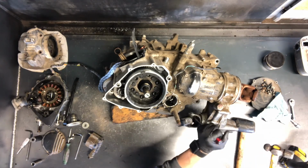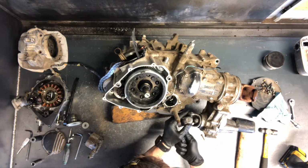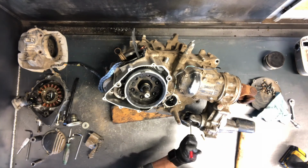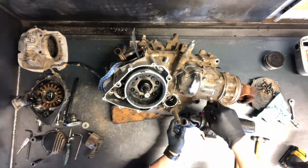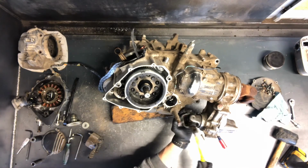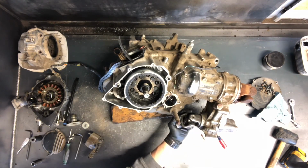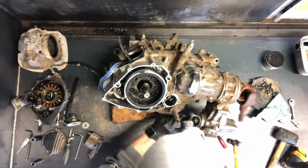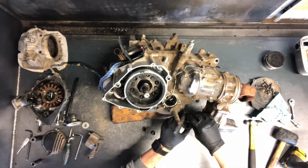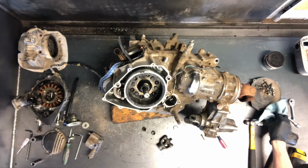And once you find those, what I do is tap them. A lot of times that'll move them enough to where you can get your screwdriver in behind there. Pry it off. Again, on this side, still dealing with the yoke that's attached to the motor. Pop that clip off of there. Now what I do is stay with the metal hammer. Take that cap off of there. Spin it. Pop that off there. Now, all we have to do is pull this shaft here.